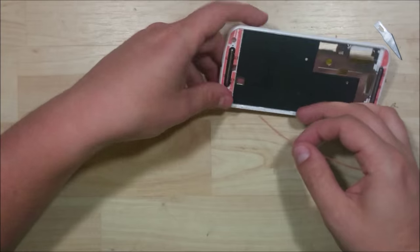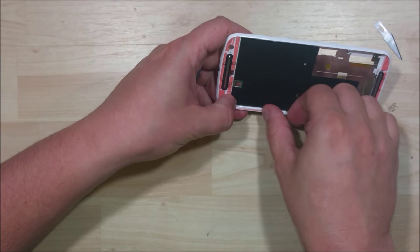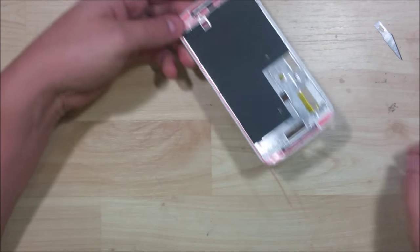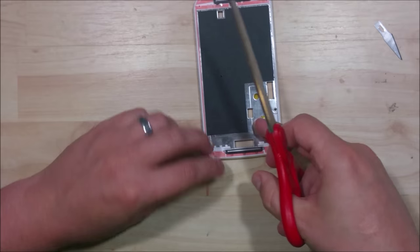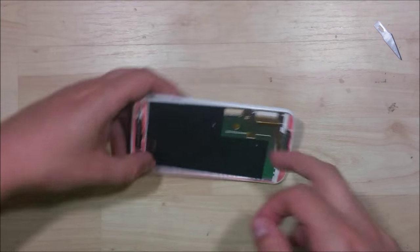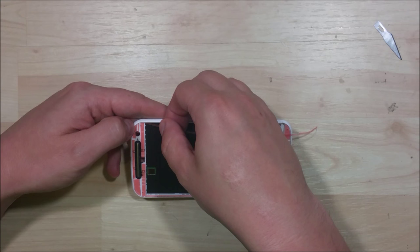Now this is a really important place — you want to make sure the tape is butted all the way up next to the side that pulls upward on the bezel. Use your tool to make sure you push it down and it lays flat. You don't want anything overlapping into where the display is going to sit — the actual cutout in the middle. You want it all up on the sides of the phone, otherwise you can get some pressure backlight issues.